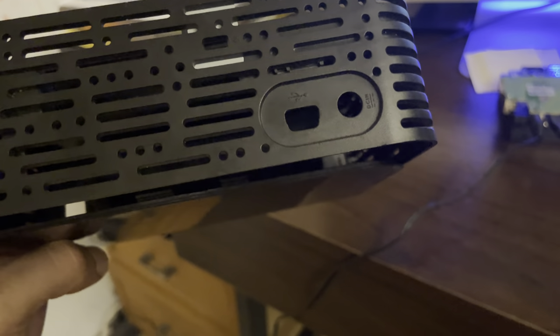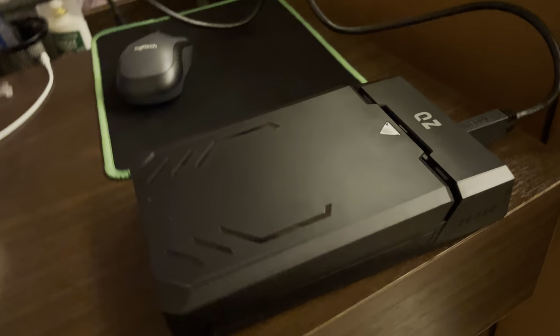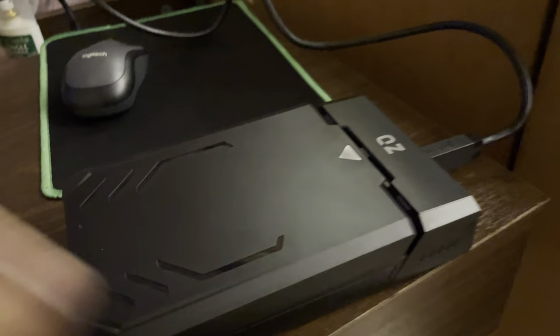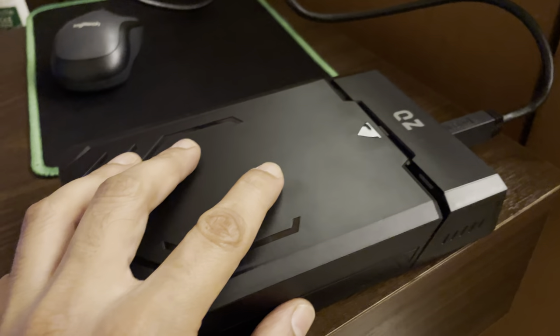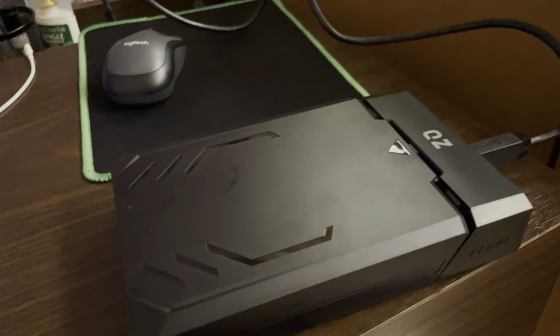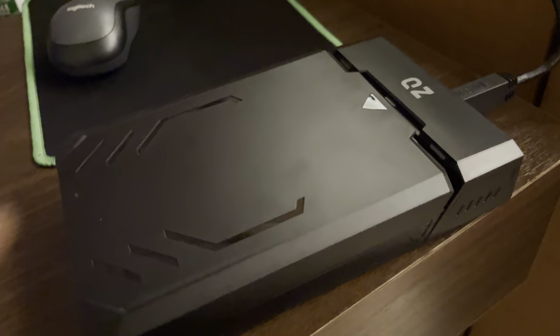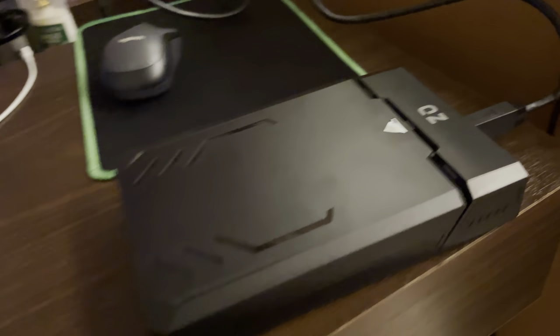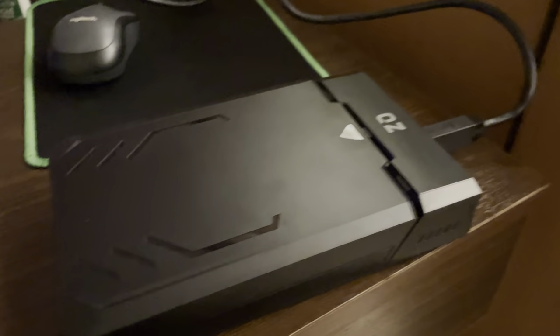Keep in mind, these were powered drives and I didn't have the adapter for them, so chances were slim of powering them on. Anyway, I put the Time Capsule drive in the enclosure — it was a Western Digital Green, I think Barracuda. I plugged it into my Mac. The lights would come on — a blue and orange one — but no blinking, no activity, no spinning. I tried it in Windows. The drive was visible, but it didn't have any directory — it was just a grayed-out drive.